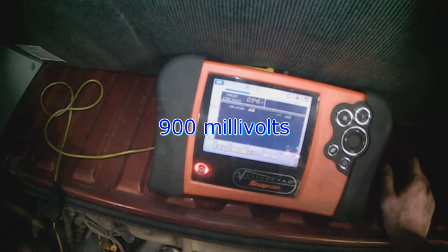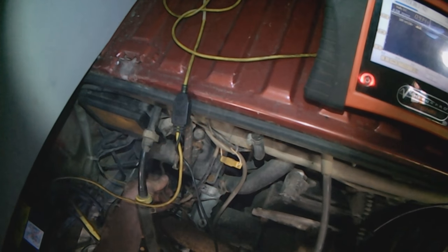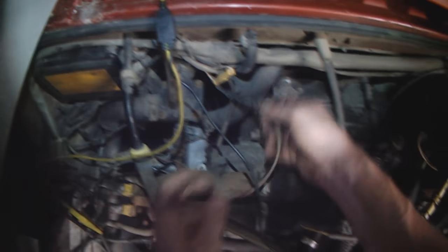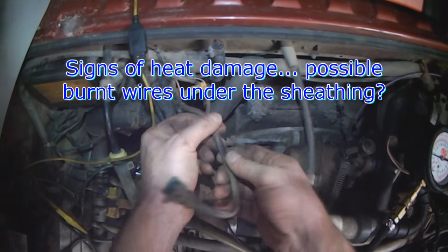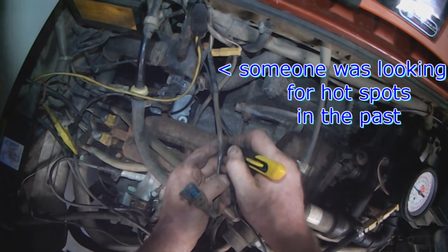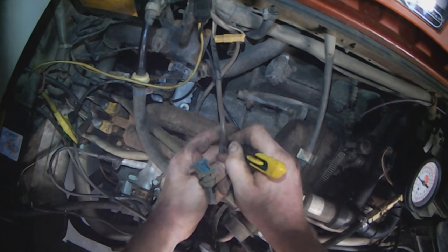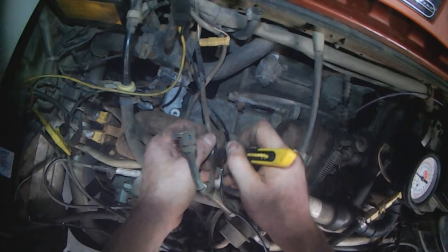You can see it's basically stuck at 900 millivolts and I get smaller richness. So there's a problem in the wiring or on the connector — there's electrical tape here, so somebody was in here before. Whether or not it's related to up here I don't know yet. The pins themselves might look a little corroded, but there's what looks like a hot spot here.